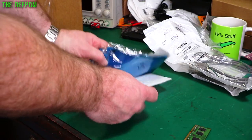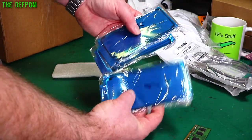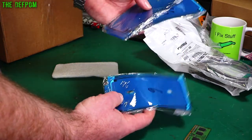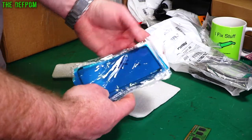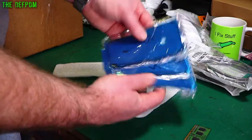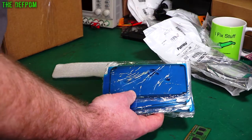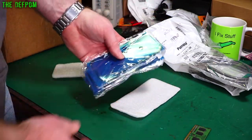These are waterproof sticker membranes — 6s and 6 — so these are for the iPhones. You put these around the screens, on the frame of the phone, to help waterproof them when you replace the screen. Once you've finished your work you put this seal on. It doesn't make it fully waterproof, but it reduces the chance of liquid ingress. They're pretty cheap to get. You peel one side off, put it onto the phone, push it down to get it seated, then peel the other side off and you're done.